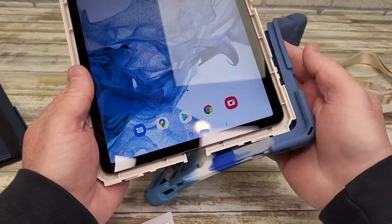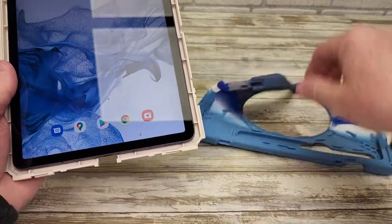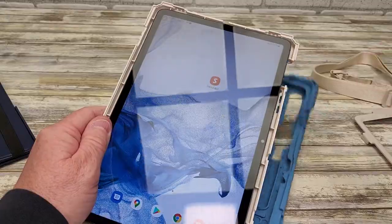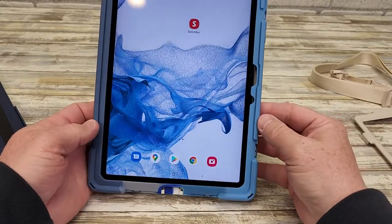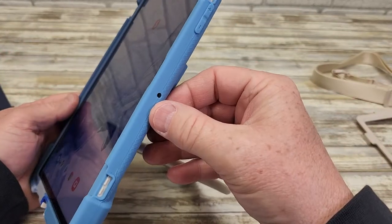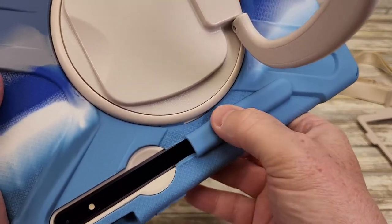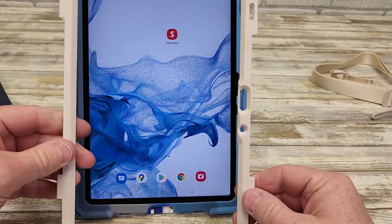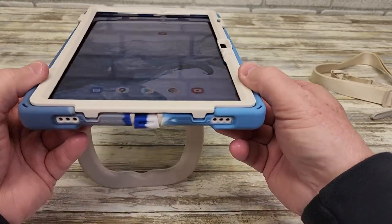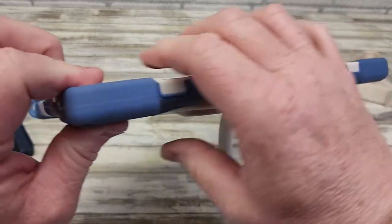Now you've got to reinstall this rubber piece all the way around the tablet. Make sure you line up where the camera lens is — see how it's got that big opening? This is going to go right here. Getting that rubber piece on wasn't too bad. There are a lot of little holes you've got to make sure you have room for, and it just kind of form fits in there. There are some pieces around the back you've got to get back into those little grooves. Next, take the frame and line it up with the camera lens, and snap this on — these pieces just snap on, and you follow that all the way around.